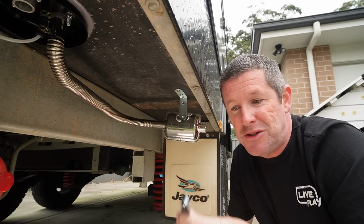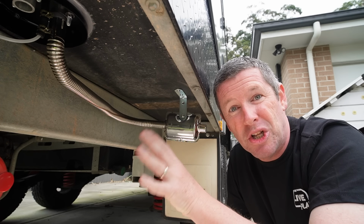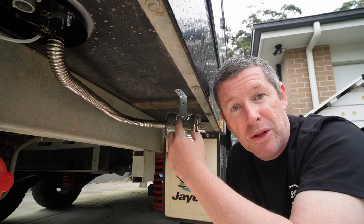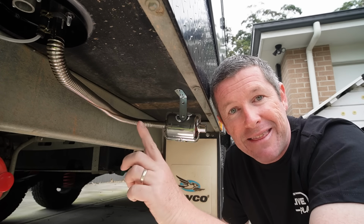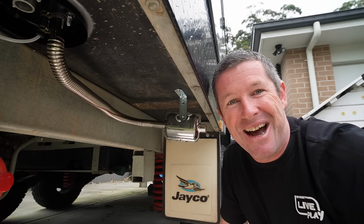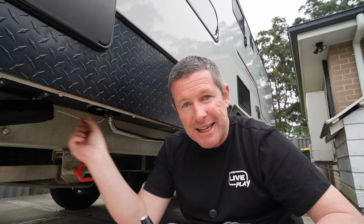And I've actually used one of the same L brackets that I used to put the fuel pump enclosure on. So it keeps it all nice and tidy and it doesn't look like it's being cobbled together. I've also used the same M5 bolt and nylock to tie it all together, and that generally has it all pretty much done. I've got to put the clamps on, but I'm going to get the air intake on first, and then you can see how it all looks once it's all buttoned up. And then with the air tank, I've shaped it something like this, and everyone's instance is going to be a little bit different, but I'm just trying to tuck it up under the floor, which will actually sit in front of the pump.